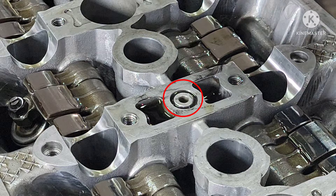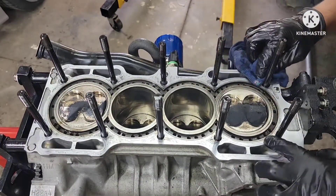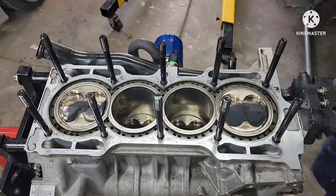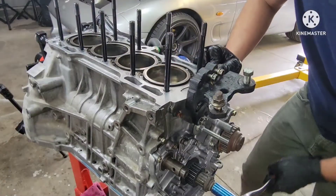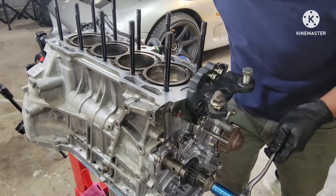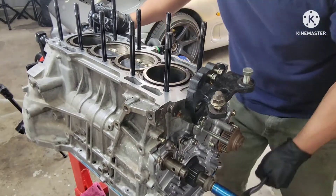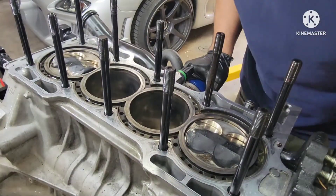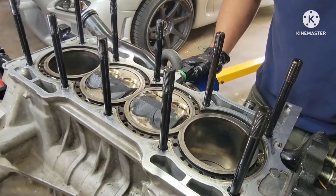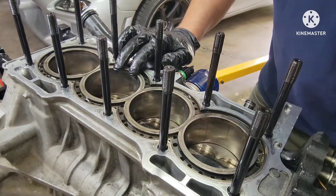Same thing on the center of the head — there's caps, there's an o-ring in there. In this case on mine there's no o-ring, so I don't know if that's normal with no o-ring. Okay, this is good guys — look at that, the piston has that dome shape. You'll always have that carbon on this side here from the exhaust side. Look at this piston. The cylinder wall — it's pretty good, I could still see the cross hatch on them. This thing has really high compression — 230 to 240 all across the board when I did a compression test. And those are just dry tests — imagine if it's a wet test, it's probably like 280 or almost 300 psi.